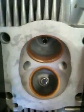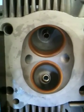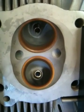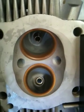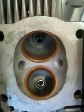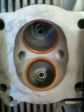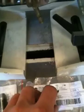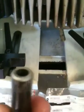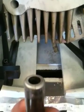Here we are today. I got a cylinder head repair from a customer. It's a DS two valve head. He basically had some piston valve contact and it broke the guides in it, so I had to replace the guides. He supplied me with the stock Ducati guides to replace, and you can see this is the exhaust that I took out and it's cracked.